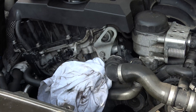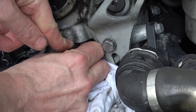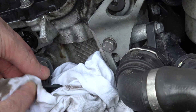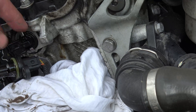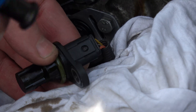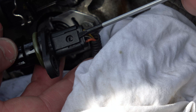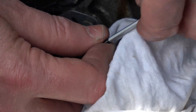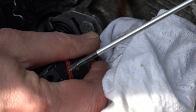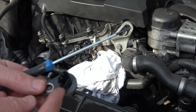I've moved this round to here and now I'm going to push down. Unlike me, you should be wearing gloves when you do this. It's just got a little o-ring on it. So that there is the sensor and we just need to undo the electrical connector from it. To undo this we just need to get a screwdriver, put it in this part here, and then lever it up a little bit and the connector will pull out. Put the screwdriver in from this side and give it a little twist, and that will allow me to take out the electrical connection. That's held in with just a little bit of rubber.